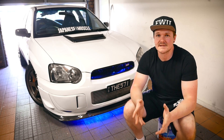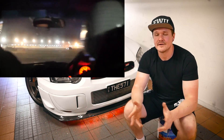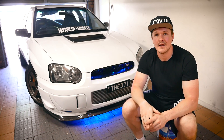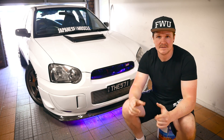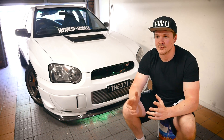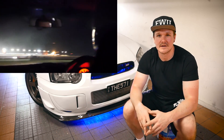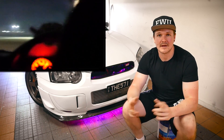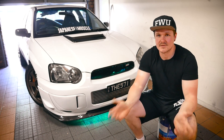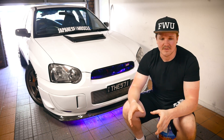So the first question was: on a scale of one to broken spine, how snappy was she? It was fairly snappy at the track. However, that was just due to the fact that I had it too low at the front. It's kind of diving in a bit hard. I haven't got the toe settings correct in the front and rear, so I'm going to put the toe in a little bit and the toe out a bit more in the front. It was also very hard for me to relearn how to drive the car — learning to let go of the steering wheel and let it re-center was a big thing, as well as handbrake entry.